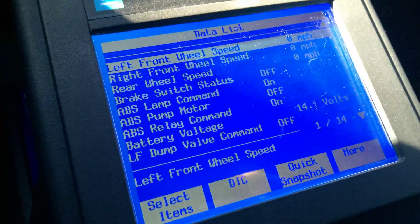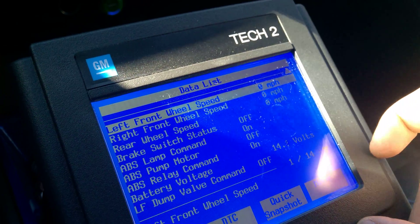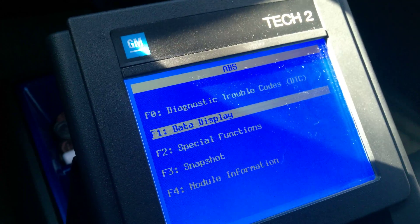So what I would look for if this were actually an issue is I would check the wiring and then check the gap. In the how-to on the forum for gapping the sensor, you'll use a small screwdriver to pound the sensor closer into the hub, which sets the gap. Once you've checked both of those things, you can come back in here, test it, and once you've fixed the issue, we'll verify it — which I'll do quickly now.